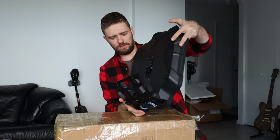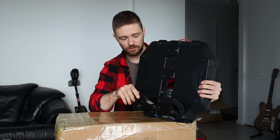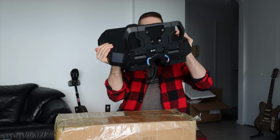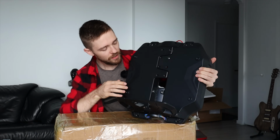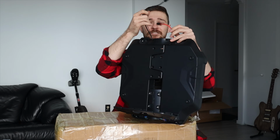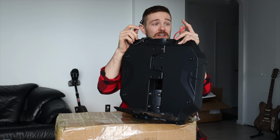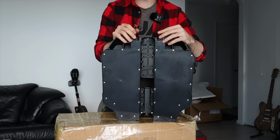If you think of it, the Veteran Sherman-S is very similar in its build to the Kingsong S22, where you don't have any L hangers. You just have essentially the pedals mounted to the battery cover. So on this side we have a very nice magnesium shell. Here the suspension will go through. We'll assemble it in a second. And right away we also have the battery wiring. Very awesome, because the plus and the minus of the battery is separate. That's great. That's so much more difficult to make a short circuit on the wiring if they're separate.